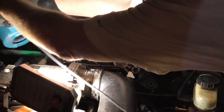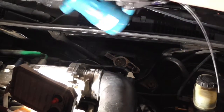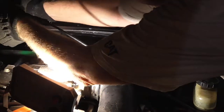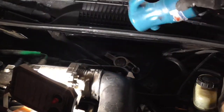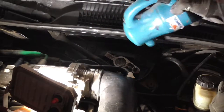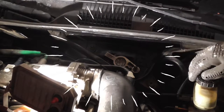I'm using the blower again. If you have a compressor, you can simply use air to be sure everything is clean under the wipers and through the vent all around. Be a little careful when you do this — you don't want to blow any debris up on top of the manifold, especially the exhaust manifold, as that could create a fire. Keep everything organized and keep it away.